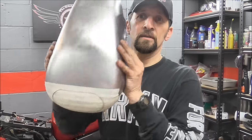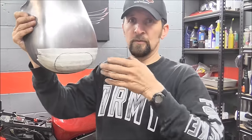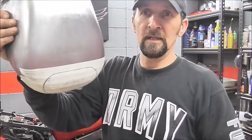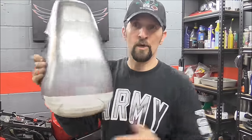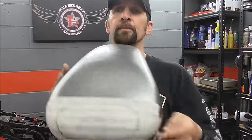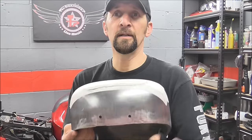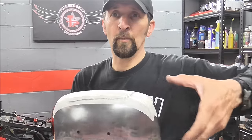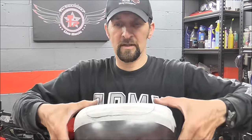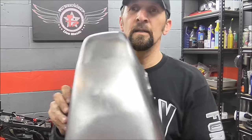That sits square and neat. Level, symmetrical, laterally correct, up and down. To the eye, which is how it's going to get judged when it's done, it's right. You can't measure anything because there's nothing square, nothing flat. And even that cut there is not symmetrical. Where I folded that lip in, there's 1.5 mil more meat that side than there is that side. So if you measure from there to there, it's cockeyed and it'll end up to one side. So you've just got to eyeball it in the end.